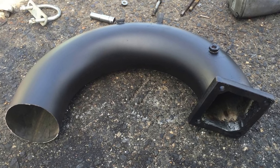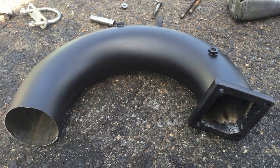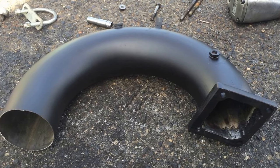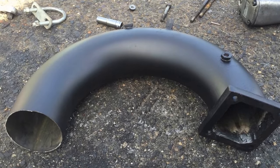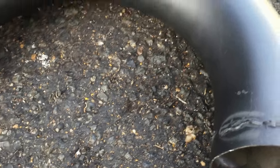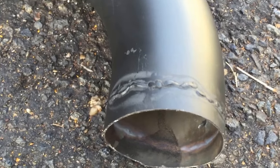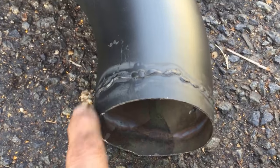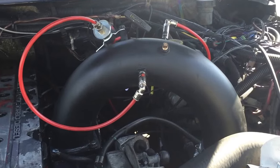You can buy these things already made. I spent about $125 to $135 buying all this stuff on eBay, except for the custom flange. To me it looks like a nice clean neat turbo piping system. One other thing you need to do is run a weld bead around the ends of the pipe so the boot has something to grab onto. If you don't, they'll slip off once under boost - they're too smooth. Just run a bead around there, grind it down a little, make it smooth, and then the clamp has something to bite down on.